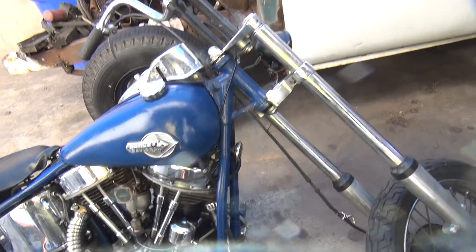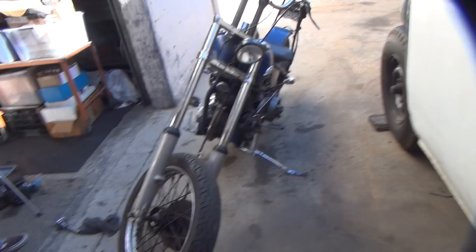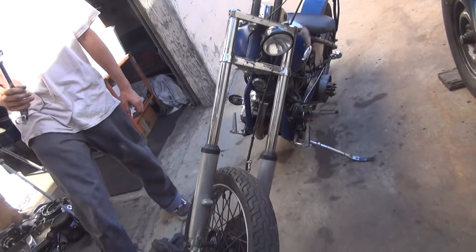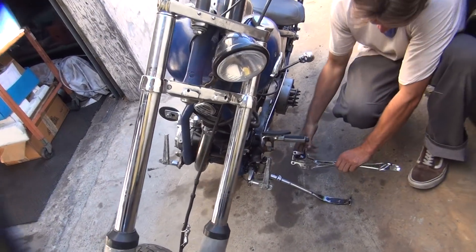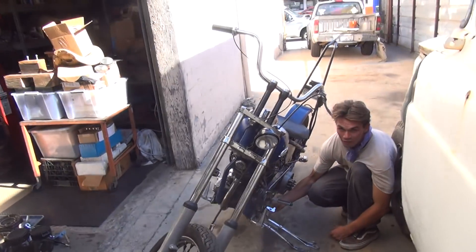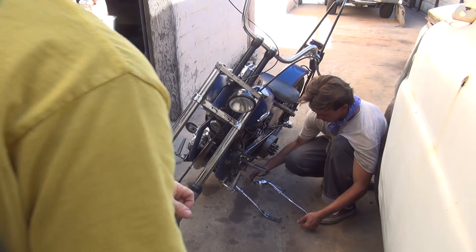The other problem is he has a lot of angle to the bike because he's got this long front end on here. So the bike has a lot of lean to it, which is another problem. So take that kickstand I just pulled out — okay, this is a soft tail kickstand. I'll lay it up on your bike there and let's see what the difference is. The leg is about the same length, but the angle is so much more. The soft tails are 7 inches of ground clearance, the FLs are 5 inches.